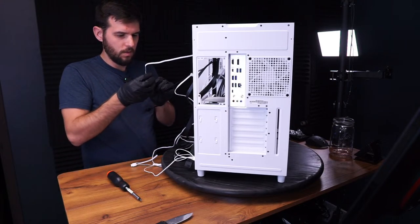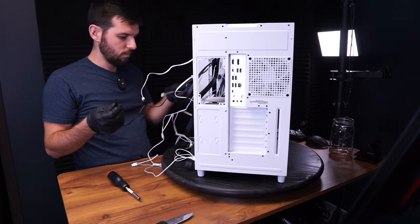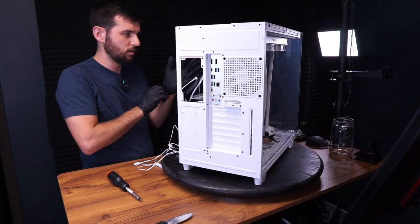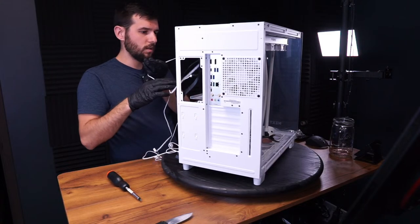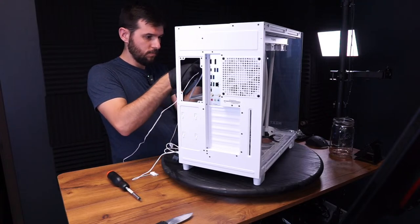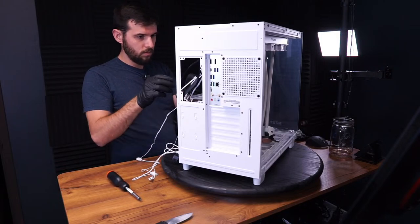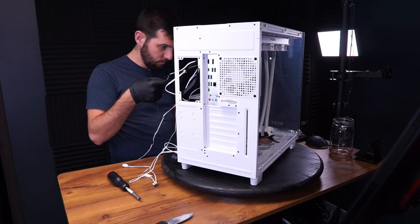Always good. I know, but that's what I'm saying. If you get the CL32-6400 from Oloy, it's the exact same stuff as the CL36-8000. Literally the exact same stuff. So you can tune it to be exactly the same timings and stuff if you want. Same speeds, everything. The real important thing for that is making sure you have a motherboard that can handle the higher speeds. So you need one of the refreshed versions, you know.